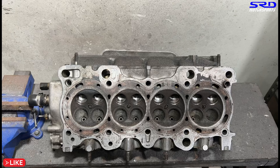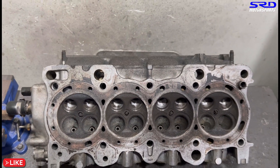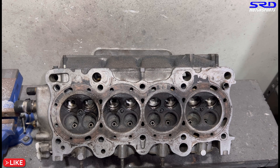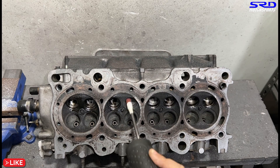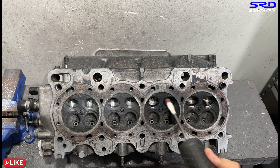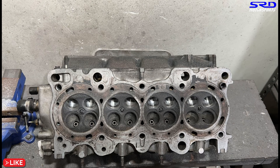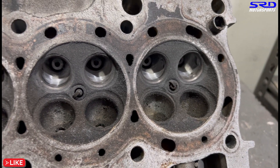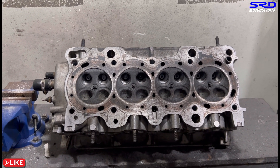That's the exhaust bowl for now. We spray some kerosene — nothing special, just plain old kerosene to get the carbon a bit looser and dislodged. Now switching to 120 grit — you can see the bit color is different. The exhaust walls are getting smoother. Looking close — it's looking good, not over-hogged. We start with 80 grit and then 120 grit to carefully get the shape that we want.